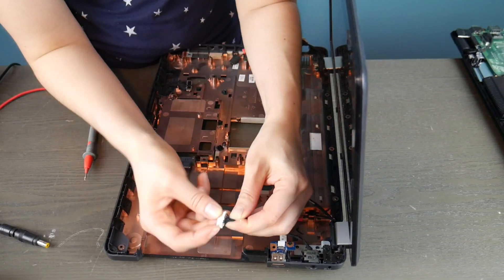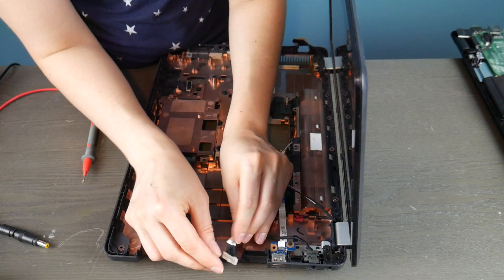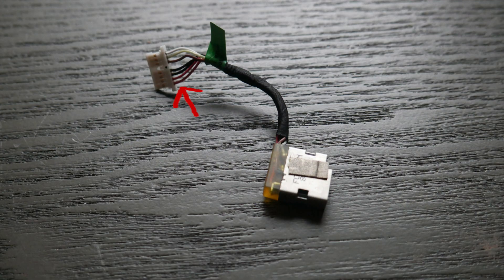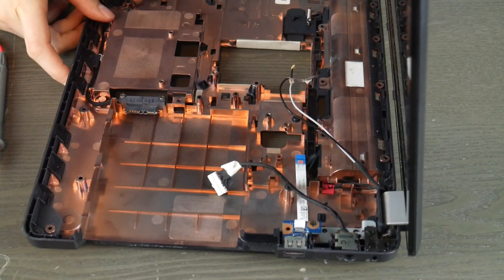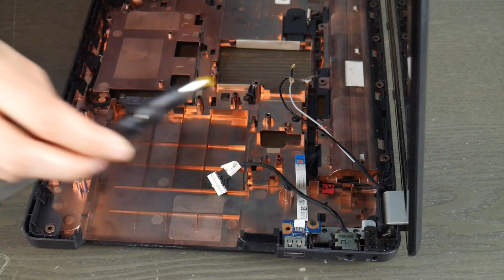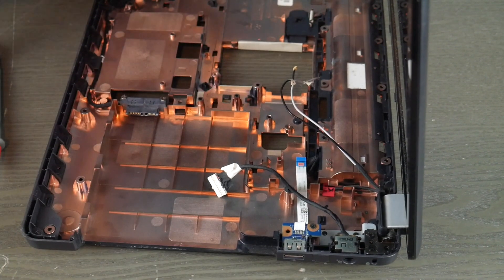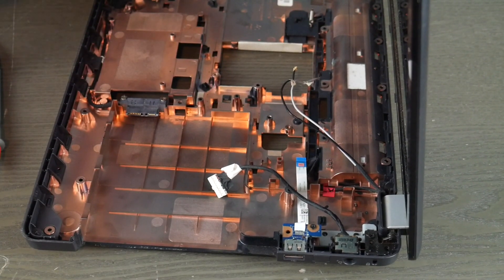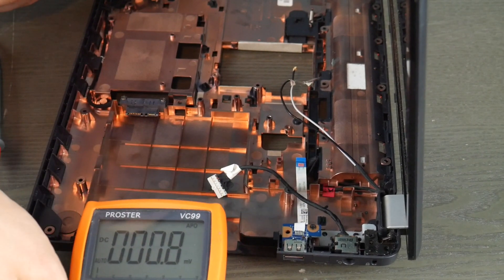This is a wired kind. Your power jack is simply where you plug in your power cord. I'm going to look at these wires — as you can see up close, you have red wires. That is where you take your multimeter and put the red prong on that. And the black prong, you'd be testing the black wires with it. So I'm going to plug it in first, and then take my multimeter and test that power jack.